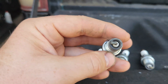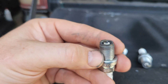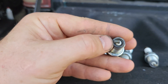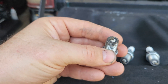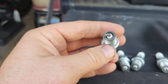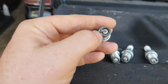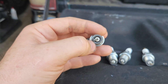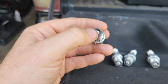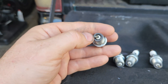Moving on to number four. Four is a little harder to see where the timing mark is, but we can kind of see it right there — see that little difference in color? That's where the timing mark is. If it starts to move toward the gap, you can give it timing. If it comes too far over toward the base of that strap, you have too much timing. I like to keep it safe. A lot of people will say 'I'm going to give that thing more timing,' but I like them right there, because I've hurt things in the past giving too much timing when I wasn't looking at all the plugs. You need to look at them all, especially with a carburetor. With fuel injection it's easier to make individual fueling changes more accurately. With a carburetor you kind of have to make a global change, and then make small adjustments like trying to direct more fuel to one side of the motor.